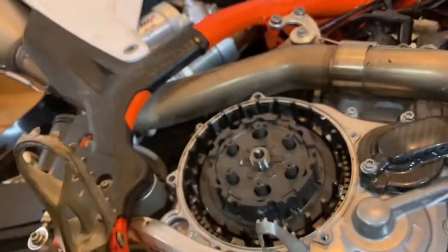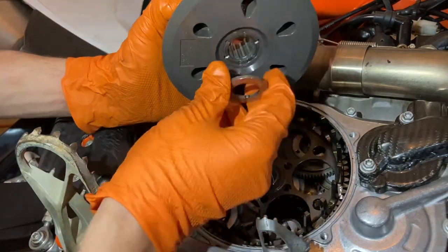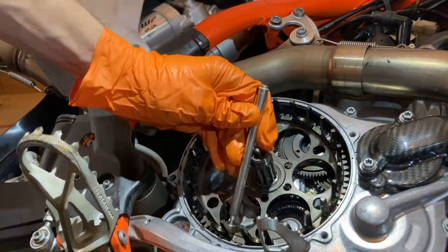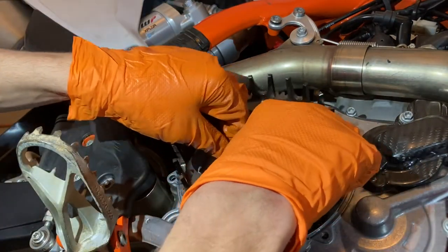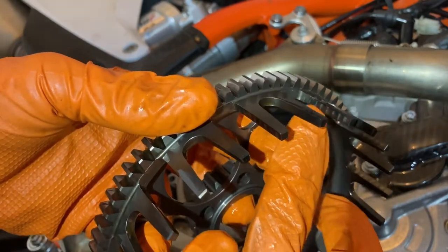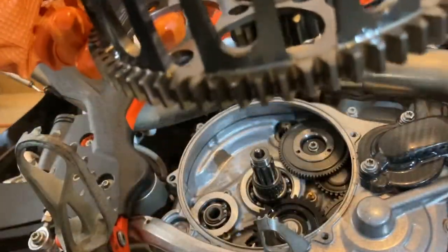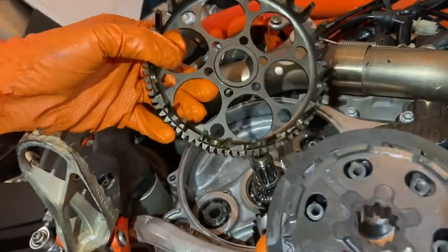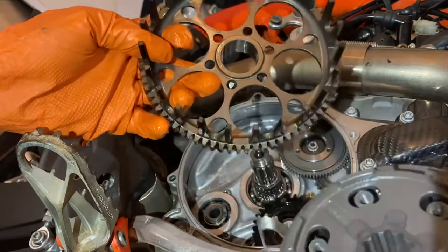We're going to take out the nut and the lock washer. You can replace the lock washer depending on how damaged it is — buy a couple of extra spares when you order parts. I used this one twice so I'm going to replace it. Unlock your tool. Now we're going to take off the clutch hub, and there's a washer that sticks to the back of it. And finally you have the clutch basket. You can see there are some imprints from rubbing, but as long as you don't feel any ridges, it's fine. This is one of the parts, along with the clutch hub, that you can replace with Hinson parts for more rigid, stiffer, and lighter clutch components.